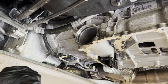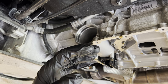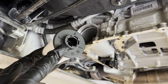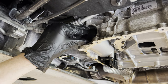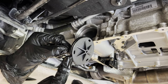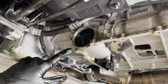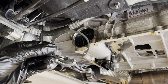Now we're going to install all the new parts. For this I put on a fresh pair of latex gloves, which I found in the bedroom — I mean the garage — because from now on the install has to happen as clean as possible. We're going to start with our new filter. There's a small o-ring which we're going to lube up, then we're going to simply slide it in the hole. Then we're going to pop on the new cap, also lubing up the o-ring. In the end I got it in with a little bit of love from the hammer — after a few gentle taps I got it in flush. Now we're going to install the new c-clip.